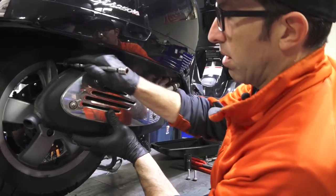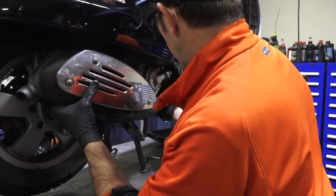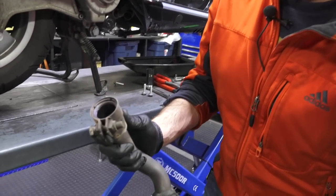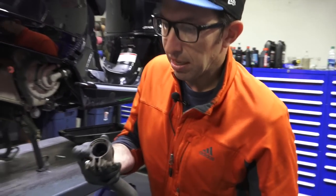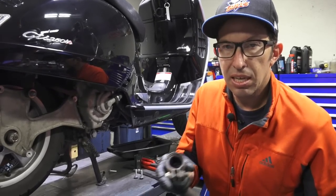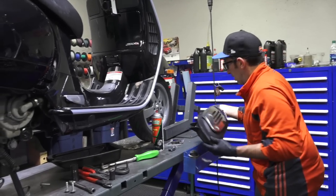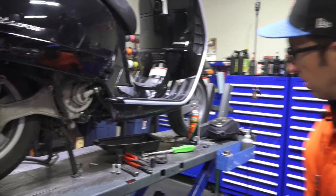Support the muffler and pull it straight off the header, wiggling it a bit. The gasket is still in good shape. The tire was recently replaced — typically if you're changing the tire, it's a good idea to change this exhaust bushing out at the same time. I have other videos covering that. If you've owned a GTS for a while, you'll be very familiar with a leaking exhaust bushing over the life of owning a Vespa.